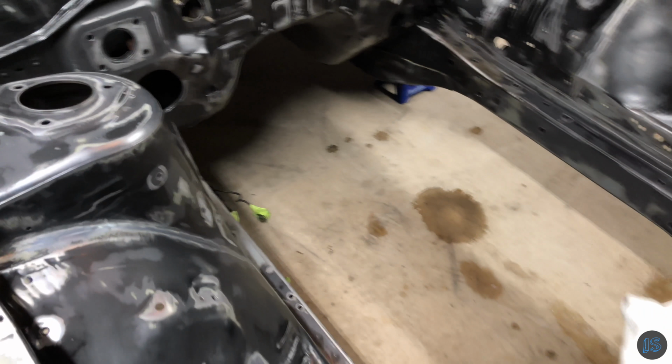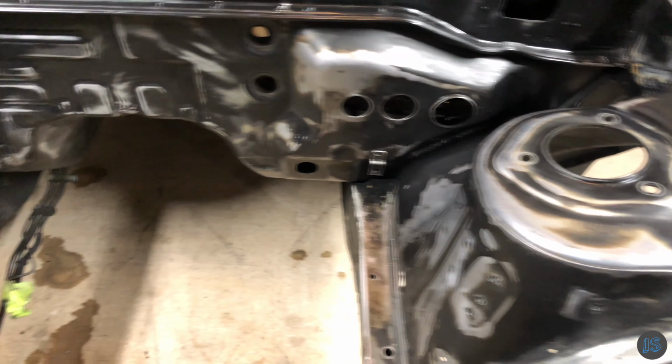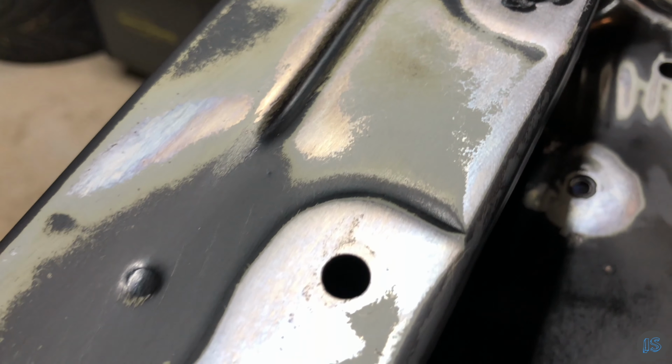After you spray down the surface with distilled water, you'll be left with something like this. You'll see a slight haze on the bare metal surface, and it almost has a shimmering color effect to it. That's the zinc phosphate coating left behind, and it's a very good thing for preventing future rust.